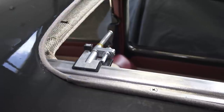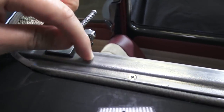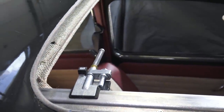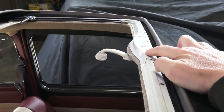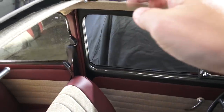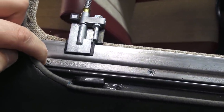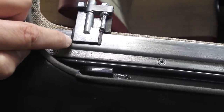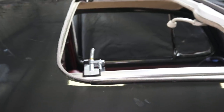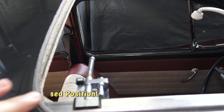Adjusting the cables was a little tricky. We had to do this a few times to figure out the placement of the solid roof. You have to adjust these cables back and forth inside this slider inside the track. What you have to do is take the center cover off, pop the cables out of the gears, then move the cables for each side to line them up. We noticed that this last screw holding the rails down — from the center of the screw head to this corner is one inch — and that basically set the center roof perfectly with even gaps front to back.